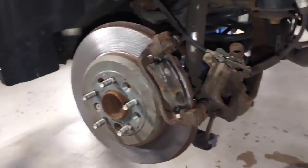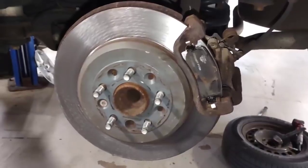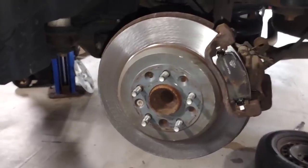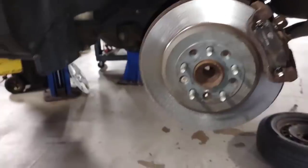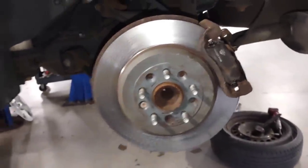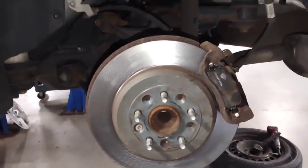Go burnish - go set the brakes in - and then go from there. When somebody wants me to do the job but doesn't want me to replace everything and just wants to get by with the minimum, one hour to take it all apart and clean it - which is probably going to take me more like an hour and a half to two hours. I've had them leave with just a regular cut surface and they still make noise. I cut them like this and even the used car guys with wholesale stuff will cut them the same way. It just makes them quieter, and after 500 miles it's back to normal - it brushes through the surface and you get a good pad seating.